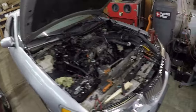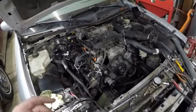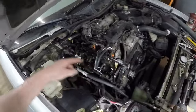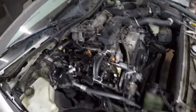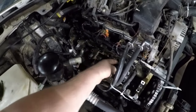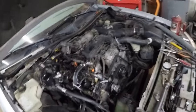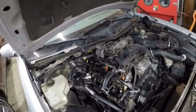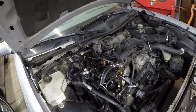It's kind of a pain. Because as soon as I put the battery in it, it fired right up, but then it started missing and farting, and I left the rocker covers off because I wanted to make sure oil was coming up, but there was nothing coming up. So I thought, okay, maybe it's just starvation. So I pulled the lifter out and I filled the galley, all these up, with oil, but nothing's happening. So either the oil pump has gone, or it's blocked up with all the crap that he ran through the system. He must have just kept on driving and driving and driving.